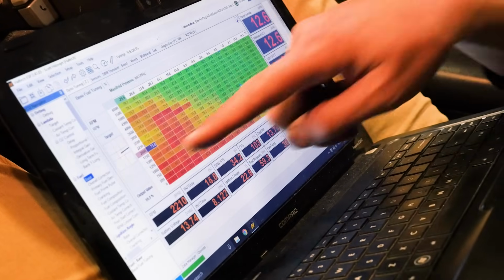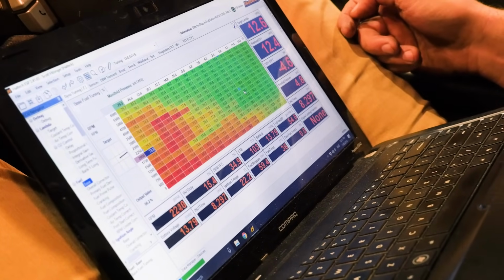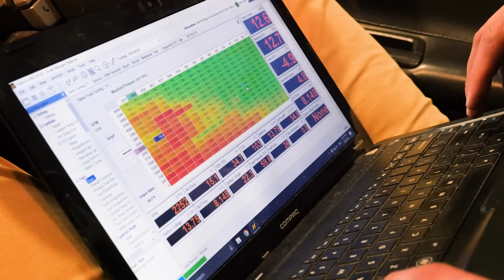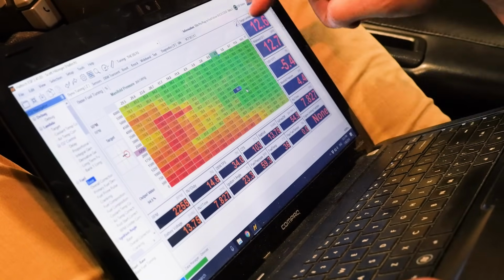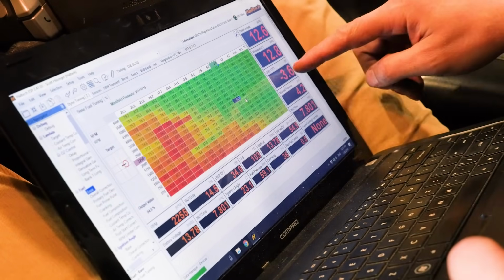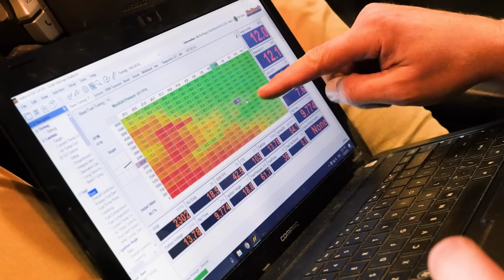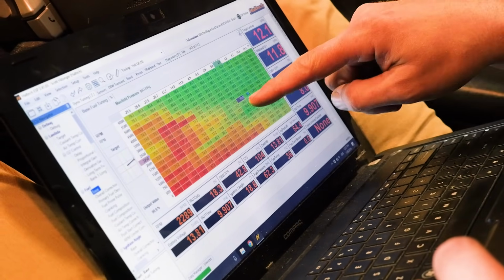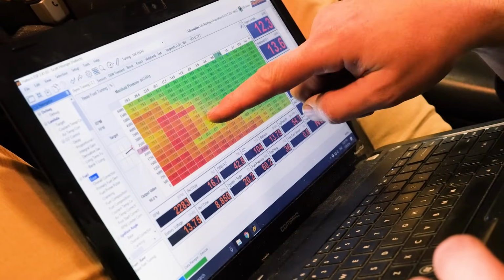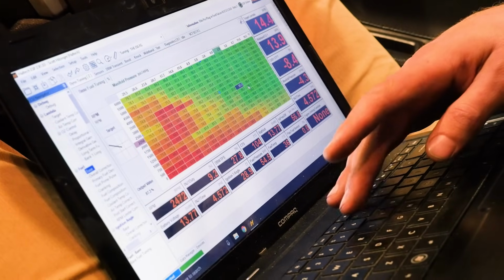My next load site, 2250 RPM. There we go. I'm now at 2250 RPM. I'm at the next load site up. I can go through and I can see my mixtures. I can see my ignition timing. I can see what my short-term O2 corrections are doing. More throttle position, up, up, up. Less throttle position, down, down, down. More and less. If I let out more RPM, I can put the trace on here in the Haltech software.